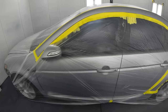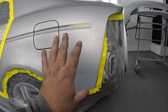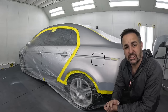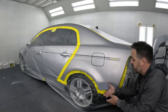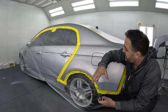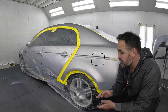Today, we'll be using this older Acura TL to demonstrate a perfect blend on the quarter panel. The damage is at the lower quarter panel and we'll be blending our color and then clear coating the rest of the panel. It's more than just getting the best settings — it's all about the preparation. That's key. Also, give yourself enough room. We have a small area, but our paint will extend further up, so clear coat the whole entire panel for the best result.